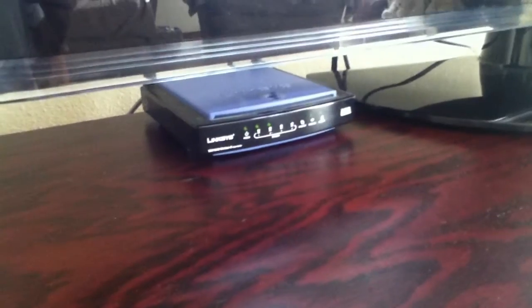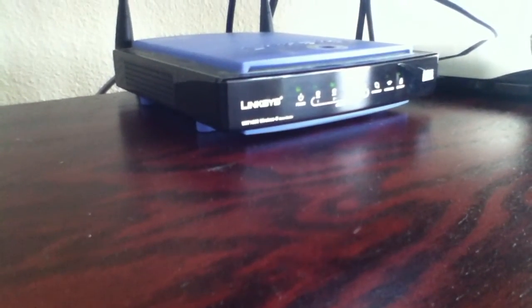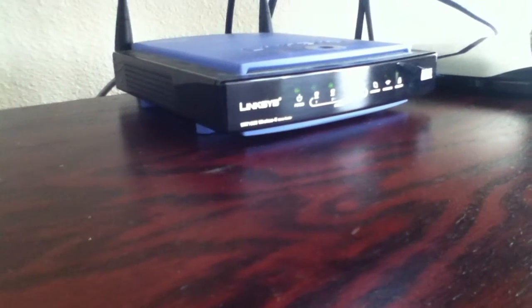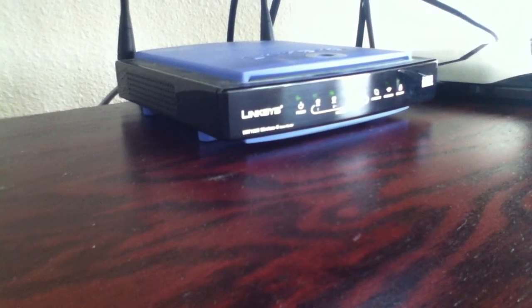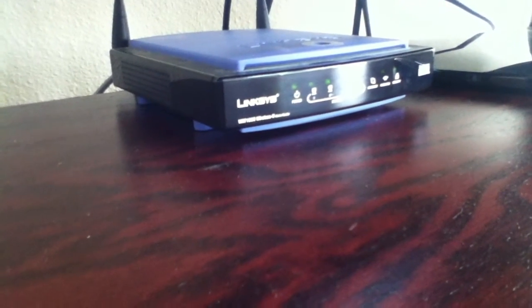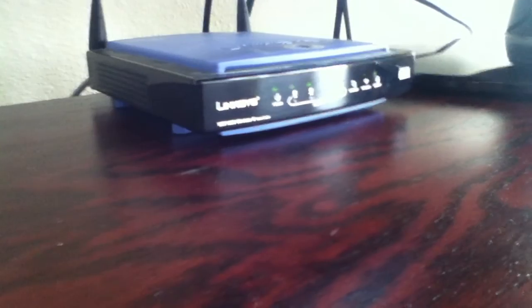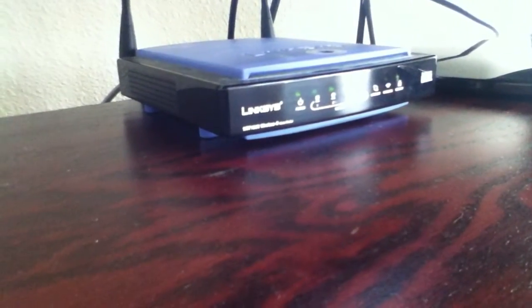So that is how I do it — basically a wireless bridge. I might have a video in the future showing you how to actually do this and get the custom firmware on your router. This works on a variety of Linksys routers. The reason I said it was $25 to $30 is you can get a WRT54GS or G wireless router on eBay for about $25 and pay about $5 shipping, so about $30 shipped to your door. You install the custom firmware on it and you're in business.